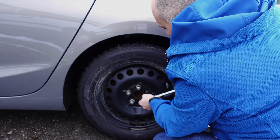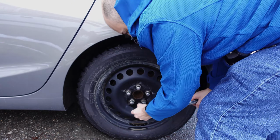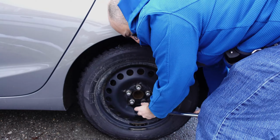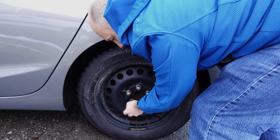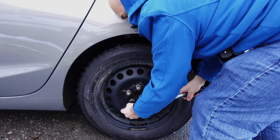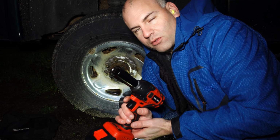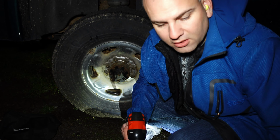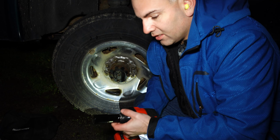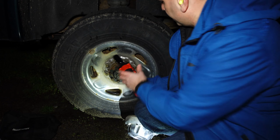I didn't want to go too far, so I didn't have to snap these nuts. It's the nice part about the semi-press on the trigger. You can stop easier. Okay, now we're at a truck that's 135 foot-pounds or more for torque. I tried my torque wrench set to 135 and it clicked without even moving the nut. So I'm going to see if this works.